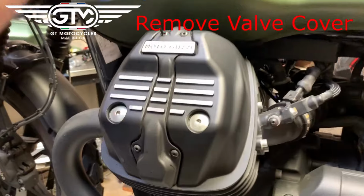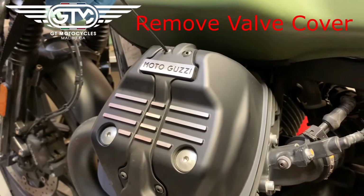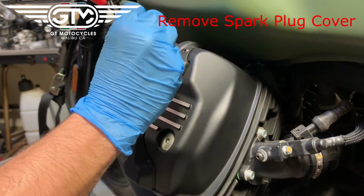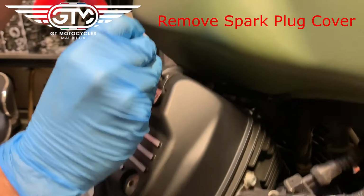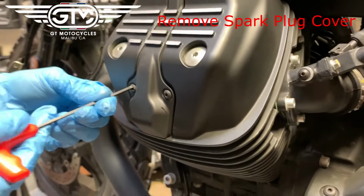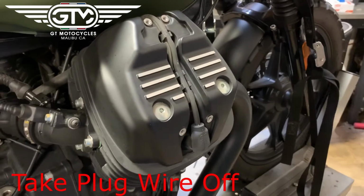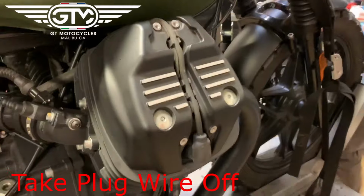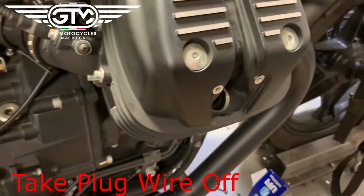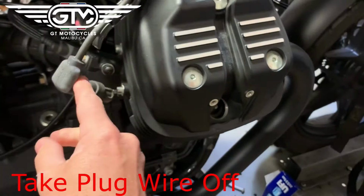And next we're going to remove the valve cover to get access to the valves with valve lash. So first you'll pull the spark plug cover by those 4 small Allens. There's 2 on top and 2 on the bottom. And as you can see, the plug wire hides underneath, and we'll just pop the plug wire off and put it to the side as you see.